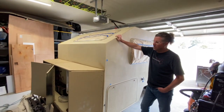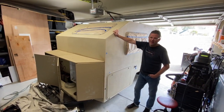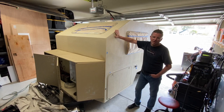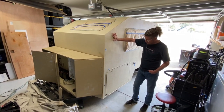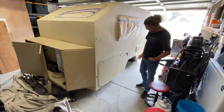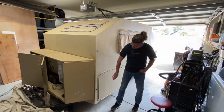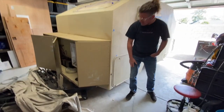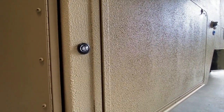So we've got the eighth-inch plywood, then the fiberglass, and then the raptor lining over that - kind of a three-layer system. We're caulking around anywhere there's a joint. You can see it's gone right over the hatches and everything as well. The vents are in here, and we've started to add some electrical - you can see the little clearance button lights here, just little tiny LEDs.